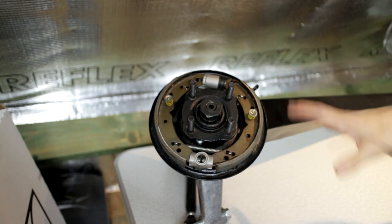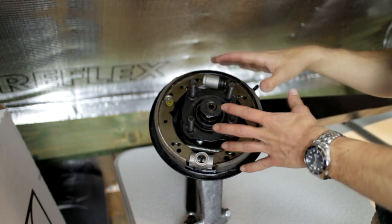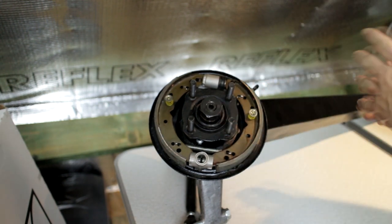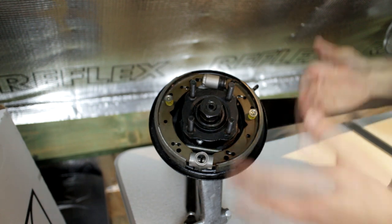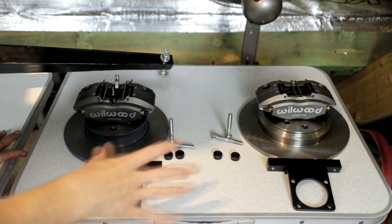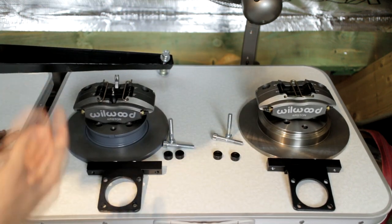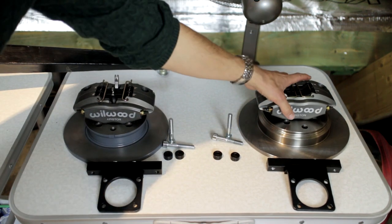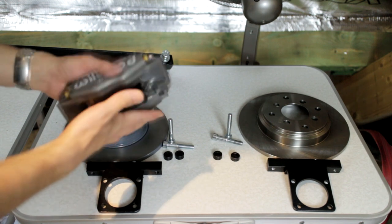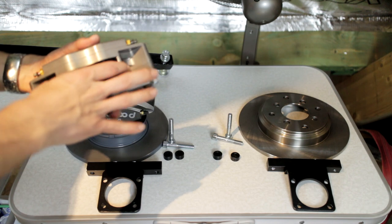What I have done is decided to design a rear disc brake kit using the original type of caliper that I'm using on the front of the car. So it's a Wilwood type caliper. This is essentially a rear disc brake kit. The caliper I'm using is a Wilwood power light. It weighs about a kilogram — it's half the weight of an original front caliper.